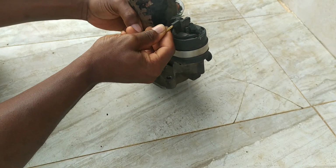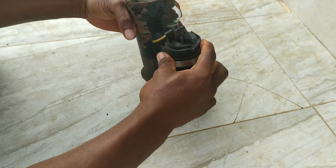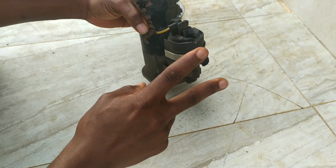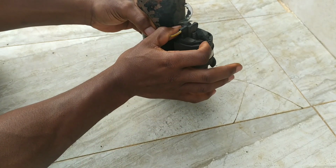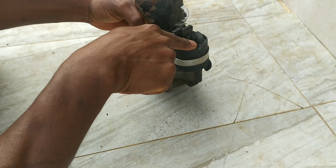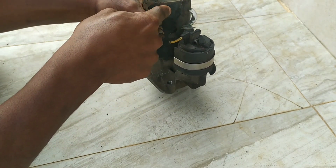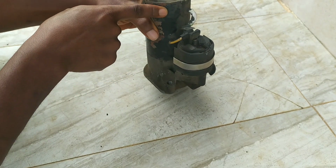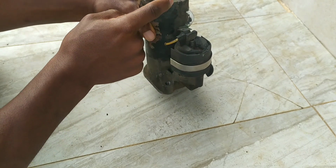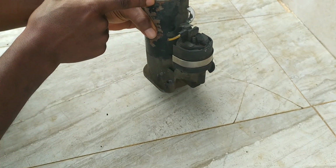once the ignition gets turned on, the solenoid gets activated. Once it gets activated, it serves 2 purposes. It bridges the contacts between the positive terminal coming directly from the battery and this terminal right here going into the DC motor portion of the electric motor starter. So that's one function. It bridges these 2 terminals together so that it powers the DC motor.